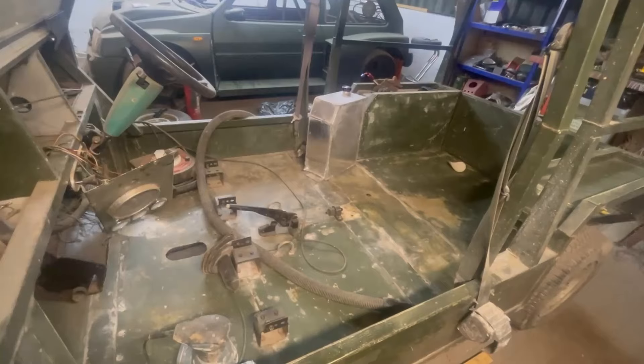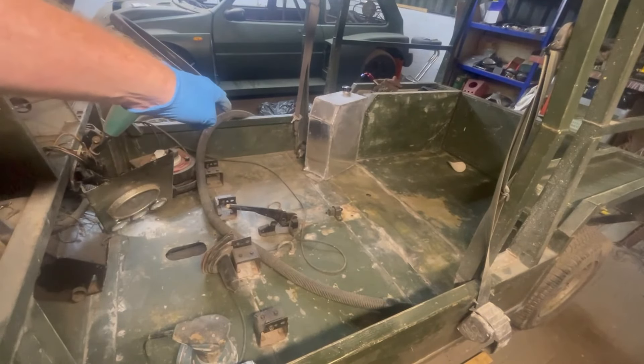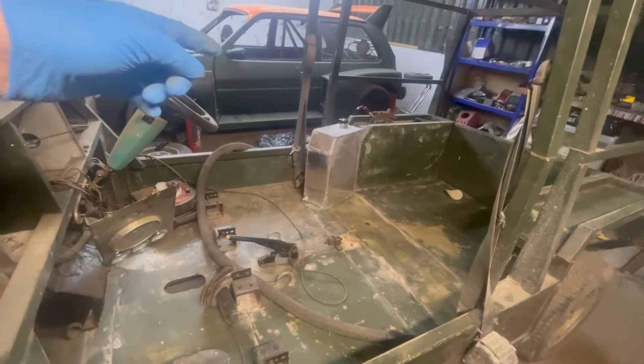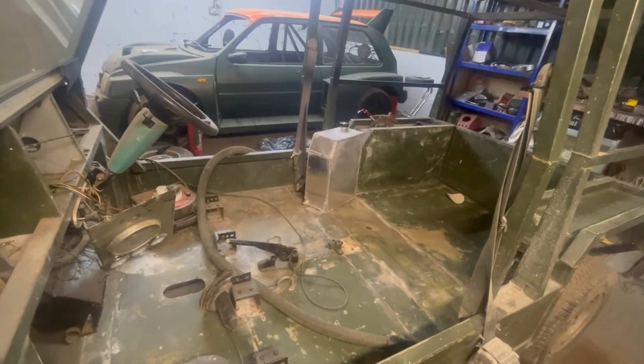We're going to rivnut through the aluminium into the steel at the back there into the rear wing. I'll take the seat belt off as well because I've come up with a good idea with the seat belts - I'm going to change them to fixed three-point things. I don't need inertia in here, I just won't be driving it down to a local car show. Fixed belts will be fine as long as I can reach all the switches. Let's drill some holes and get our mounting done.